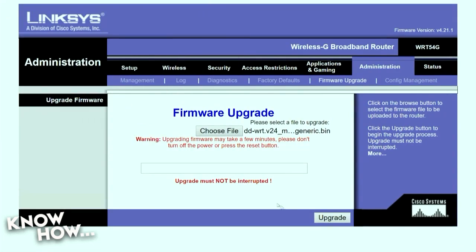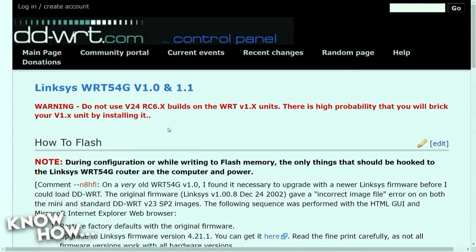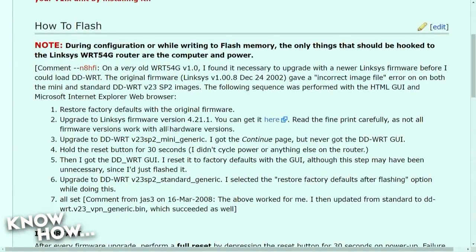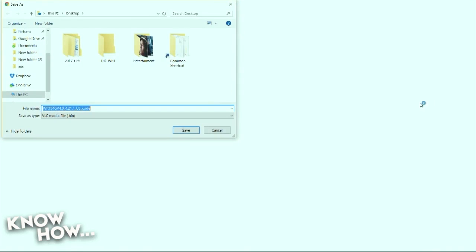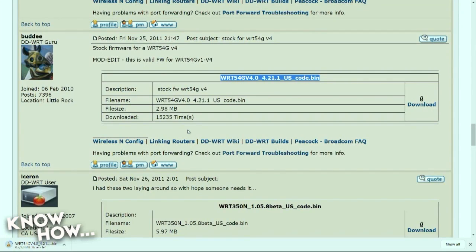This is custom firmware, which means not everything will work without a hitch. For example, my version 1 WRT54G is so old that I couldn't directly upgrade to the latest DDWRT firmware. Instead, I had to first load the stock Linksys firmware, then load DDWRT. You'll need to find the proper way to do it with whatever routers you're using — a little tricky since Linksys no longer offers that firmware for download off their site, but nothing a little Google search couldn't fix. Take your time and get it right; you may not get a second chance if you brick the device.